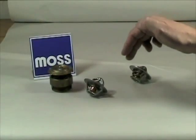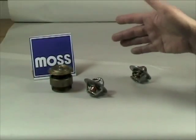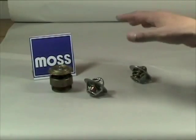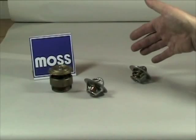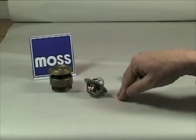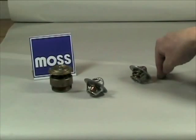The other area where they differ is the temperature. Classic British cars had thermostats running from about 160 to perhaps about 180 degrees, and you can buy varying thermostats in whatever temperature range you want. A great many people believe it's a good idea to run a 160 degree thermostat in the summer and a 180 degree thermostat in the winter, and if you want to do that, that's perfectly fine.